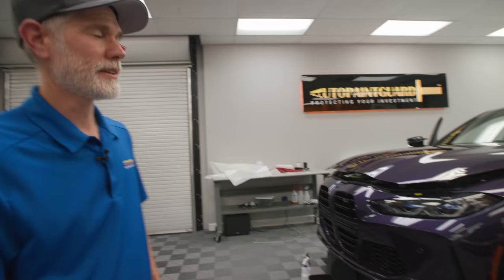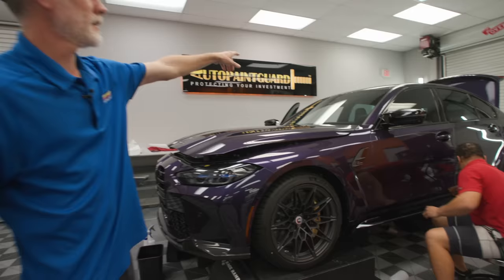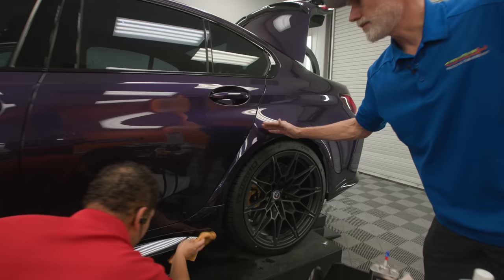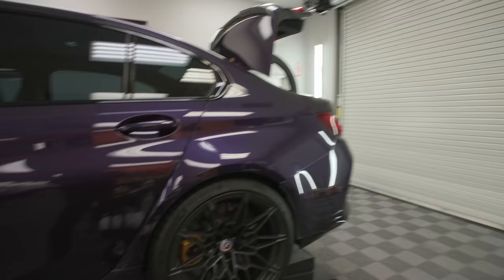A lot of times when you wrap these edges inside an AC shop - 72 degrees in here all the time - when you get outside the heat will make it soft and let go. Whereas if you already heat it up prior, it'll lay down easier and grip better. We're pretty much done for today - we did the full front lights, all the trim work pieces, full hood, full fenders. Tomorrow we're actually going to do the mirrors, wrap up the roof - Jonathan here is doing the lower rockers, the lower doors, and we're putting a bigger factory piece on the rear fender that actually wraps the edges. Taylor is wrapping up the rear bumper right now. Tomorrow is going to be fine tuning day to make sure there's no bubbles or any edges popping up, tighten it up, and get it ready to go back.